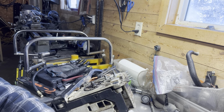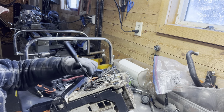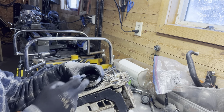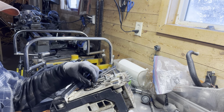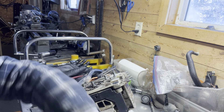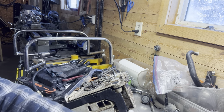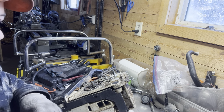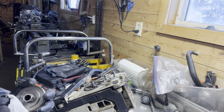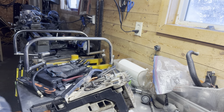There's a little needle bearing in there — this one here has not been greased for that duration either. Stihls don't have a grease port on top of the crankshaft. Some of the Husqvarnas do if they've got the outboard clutch, where the clutch sits a different way, but Stihl doesn't do that, so you have to take them off and manually grease them. I really recommend, instead of these spur sprockets, if you're looking for a heavier duty saw you're going to use quite a bit more, you want to go to one of these rim drive sprockets.